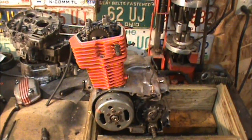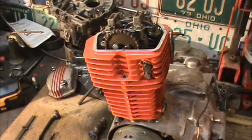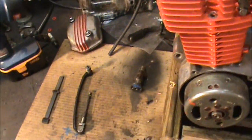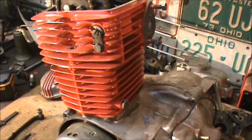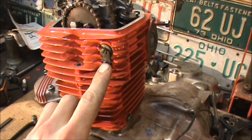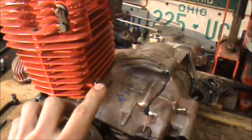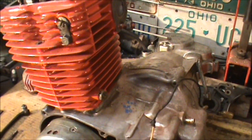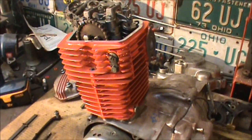So there's a quick basic on setting the timing. While I've got this all out, I'll go ahead and show you a little bit about adjusting your timing chain. To adjust your timing chain, you have an adjuster right here for more fine tuning, and you have an adjuster right here which you'll start with if it's pretty bad.